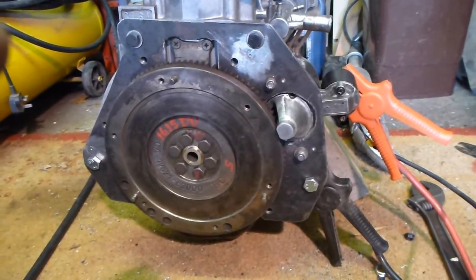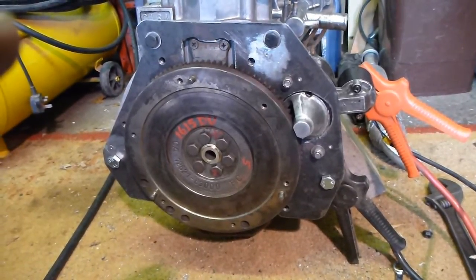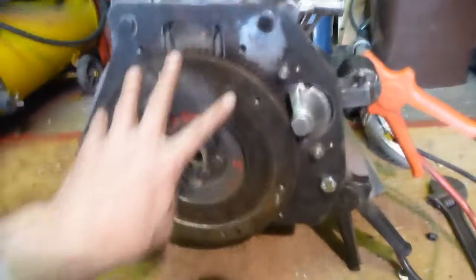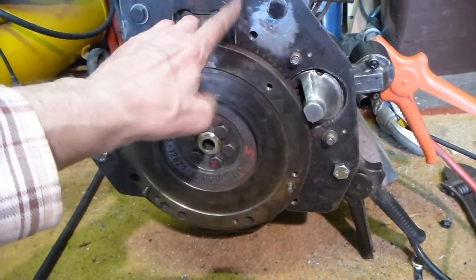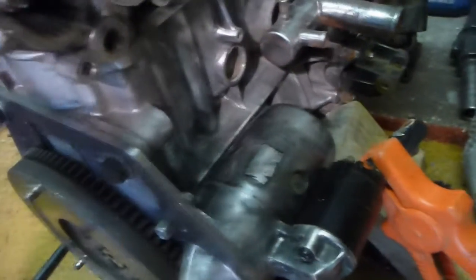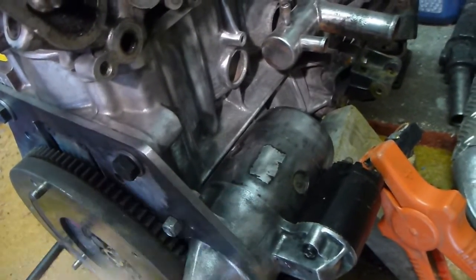OK, we've got to a major point in the adaptation of the engine to fit the old gearbox. I've got the adapter plate here, which is bolted to the engine. I've got a smaller 10-inch flywheel from the Jimny, rather than the Vitara. I had to use a Jimny starter motor, which has been a bit of a bugger because I had to grind quite a bit of the casting on the engine block and the starter motor away.